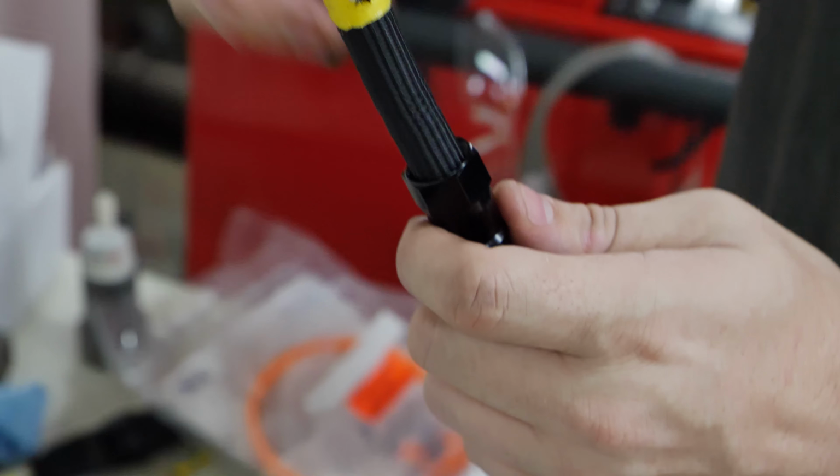You can actually do this by hand if you're nervous and you've got extra sweat on your palms. But if you need extra help, use pliers, like soft grip pliers. Do not deform this. So, just like the other version, you bring it down to the level of the olive. There you go. Last thing, this is already oiled up, but you'd oil it up.